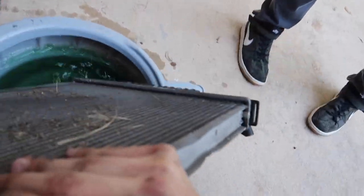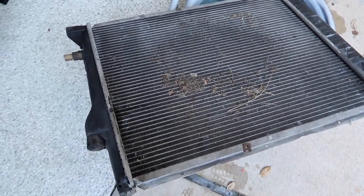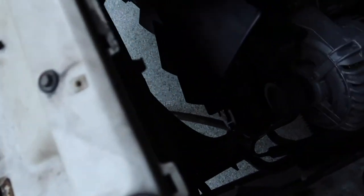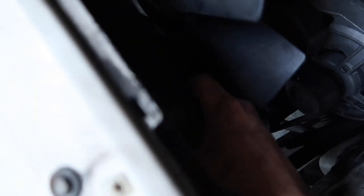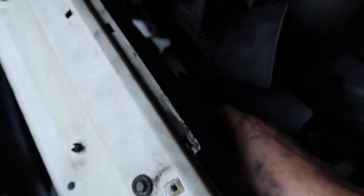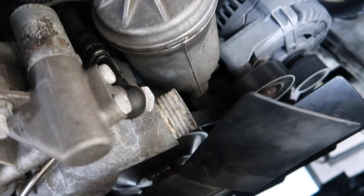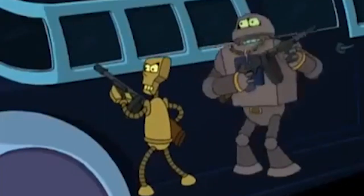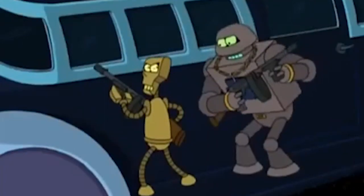She's not empty — the front has definitely seen better days. This is the sensor right here, we're going to take this out and clip it. We didn't want to take off the clutch fan, so what we did was take out the radiator first and then pull out the fan shroud — a little bit easier this way — and then put it back in reverse when installing. They sent the hoses but no clamps — you're paying so much money for the hoses and you're not getting any clamps.